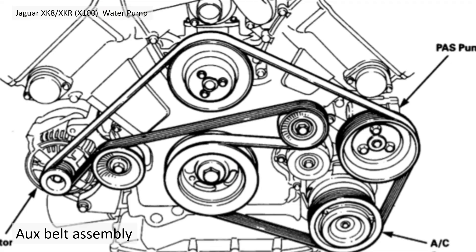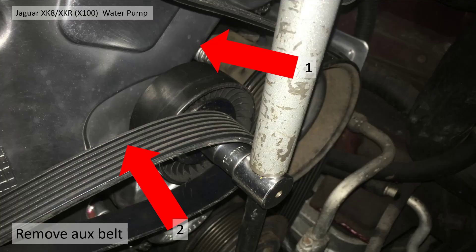To put the belt on, follow the assembly diagram. Assemble it all the way except the tensioner. If you leave the tensioner loose you can pull it back and put the belt on. Use your T-bar, 15 millimeter socket, and the bar extension. Pull it anti-clockwise — that will allow the belt to slip over the pulley on the tensioner, then release the pulley tension. That's as easy as that.